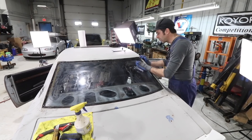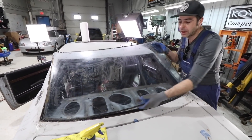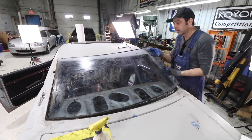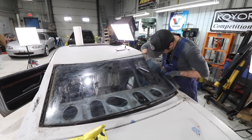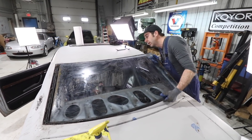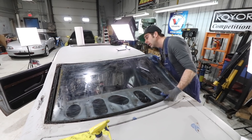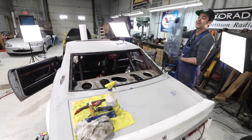We carefully went around the perimeter and loosened off the butyl, so when we push it, it should just pop up. We push gently, then catch on the defroster wire — just need to wiggle that connection free. We wiggle the glass left to right and bam — the rear window comes right out. You saved the window!